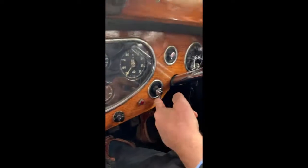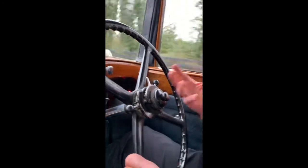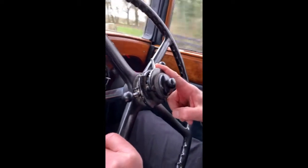And for starting, down here is the starter carburettor, where you close the main throttle to begin with — there's the starter carburettor. You'll see the effects of the engine warming up, the fueling control, especially during transients like going around roundabouts, joining the motorway. And when running in steady state, I'll move the mixture control and see what the effects of that are, see how much of an effect that has.